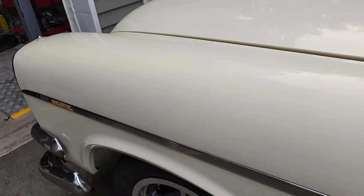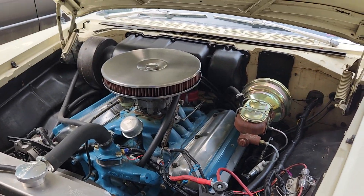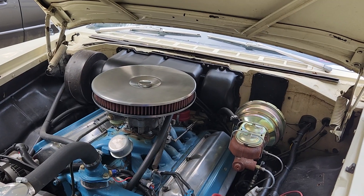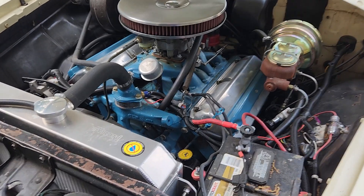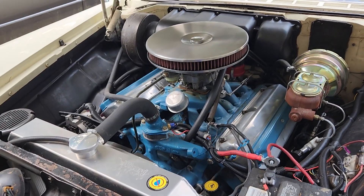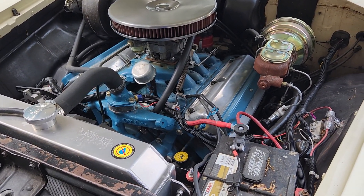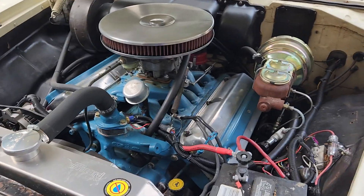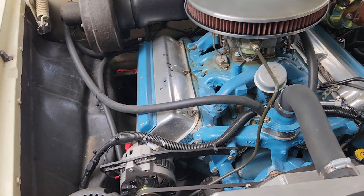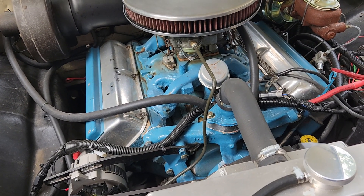The engine has been heavily modified before I got the car. That is a 325 Hemi. For the Mopar guys — in 1958 they didn't make a 325 Hemi, they made a 325 Poly. The block is original to the car but the heads are different. The only difference between a 325 Poly and a 325 Hemi are the heads and the pistons, so someone — not me — pulled the original poly-spherical heads off and put on Hemi heads. Whether they also swapped in the correct Hemi pistons I don't know, but it works fine the way it is.